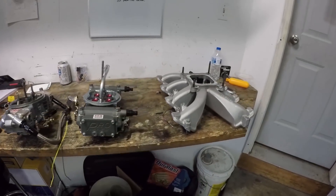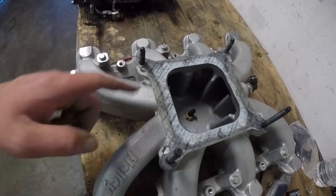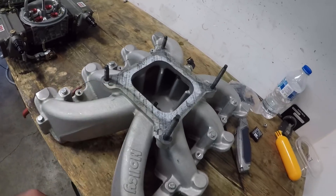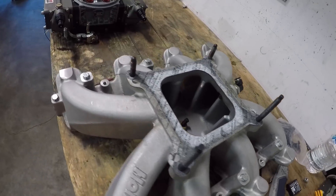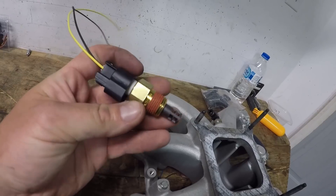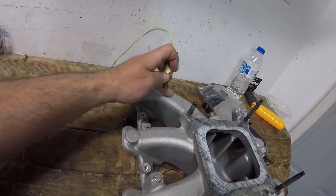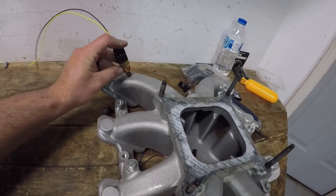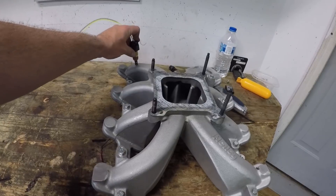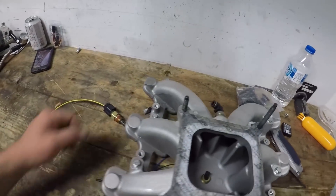As you can tell, I'm taking the intake manifold off. On part two of the testing, we already went over the wet bulb versus dry bulb. You can see we do have our sensor mounted in the bottom of this intake. We're going to mount one back in the top of the runner — they do stick in a bit, so I'll probably remove it once I'm done with testing. It's another standard sensor from GM with a quick pigtail. It's half-inch NPT, so it's quite a big hole. People are thinking that fuel will puddle in the bottom here under full throttle.